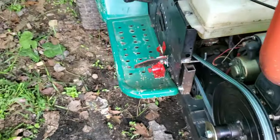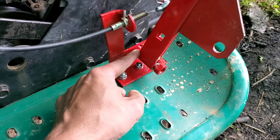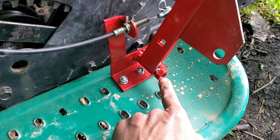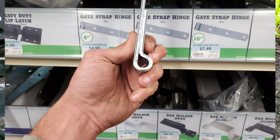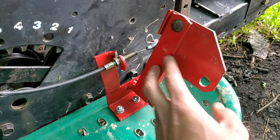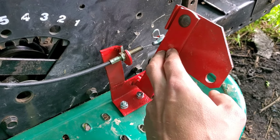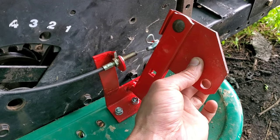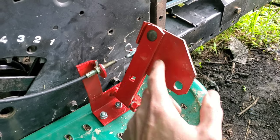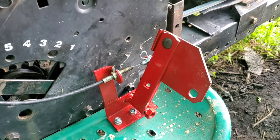On the other end we got a little more creative. What we have is an angle bracket with a bolt welded to it — a nut screwed in and welded on the inside so it can't come back off. This is just a standard door hinge that you buy at Tractor Supply or any hardware store — I'll post a picture; I think it was about six bucks. These ATV Mako cables are like $14.95. This plate here is actually the front deck holding plate that came off this machine — I cut that off and that's the plate I made my pedal out of.